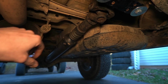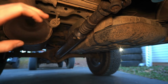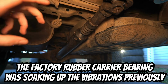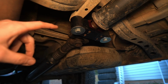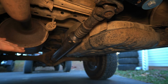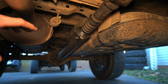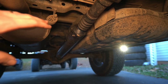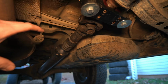You guys may notice the drive shaft that's in my truck, actually the slip yoke is up front, and that's because I had to go to my other drive line. My original drive line that I put this carrier bearing on had to either be bent or knock a weight off or something just over the years of off-roading. So I actually had a vibration, and it wasn't because of the carrier bearing. The carrier bearing just helped transmit it easier. So my drive line was out of balance, but luckily I had this spare drive line that I swapped it over to, and I put it up, and it's way better. Little to no vibrations, everything to be expected from a solid carrier bearing unit like this. I was a little worried when I first put my drive shaft on there and had the vibrations. Very happy with how it turned out now that I have a balanced shaft in there.